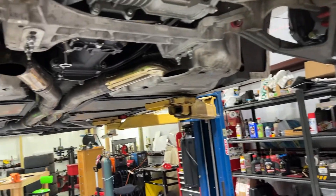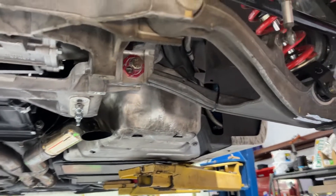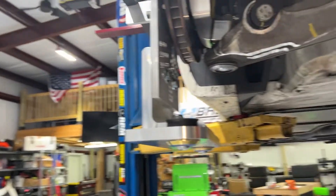What I'm going to do is back that one back down. We'll be at 2.06 and then 2.2 on this side. We'll just take some more temperature readings at the track — that's all we can do. I went ahead and flipped it back to S2; it went to 2.6, which is just too much, and I have that data based off of temperatures.